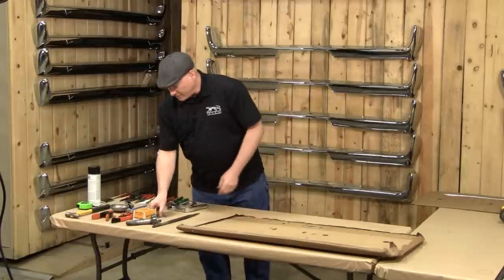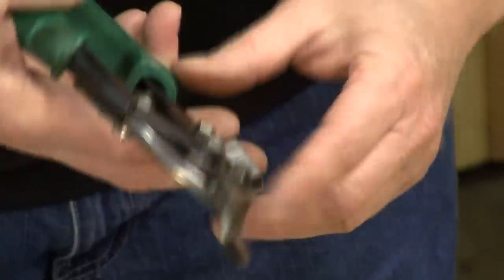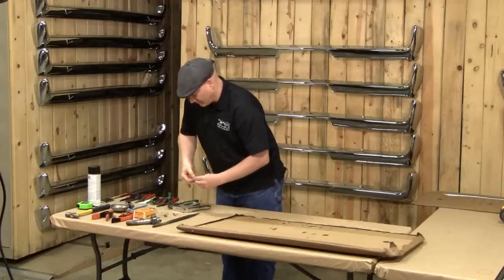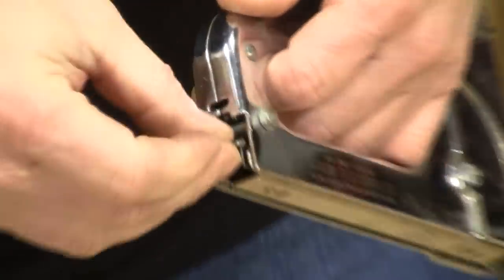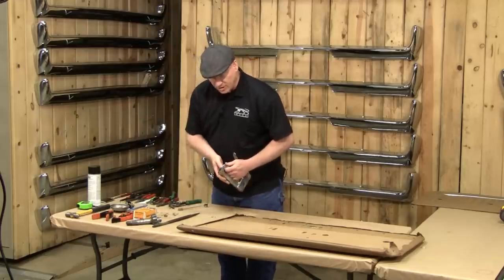Here's what I found: if you take a standard set of staples, you can measure it but you can really eyeball it as well. What we're going to do is clip off that much, then turn the staples over. You're going to have some waste here — it's not really easy to do, but it does work. What you end up with is eighth inch depth — a little bit under, more like three thirty-seconds of an inch depth. You can take these individually, and if you're careful, place them into your staple gun. They slide right down — you can hear them. Fill it up; put about thirty staples in here once you have cut them down, fill up your staple gun, and you are good to go.